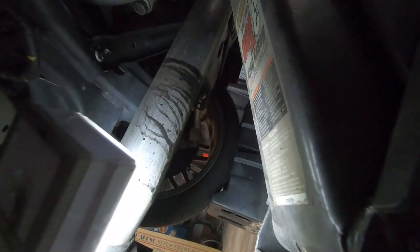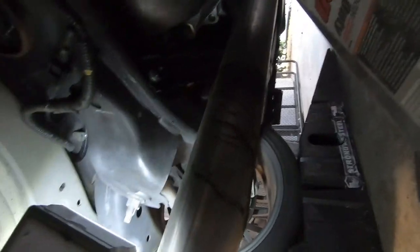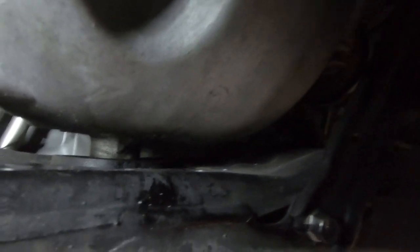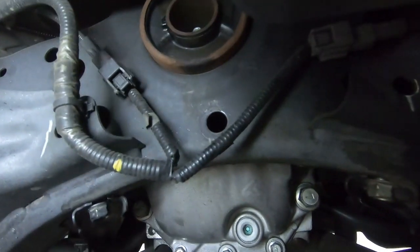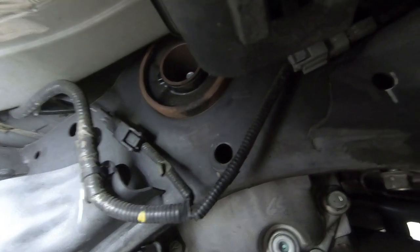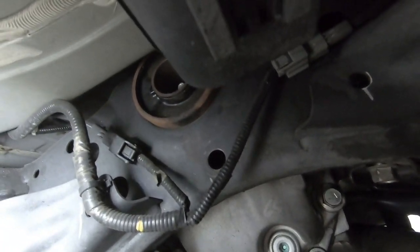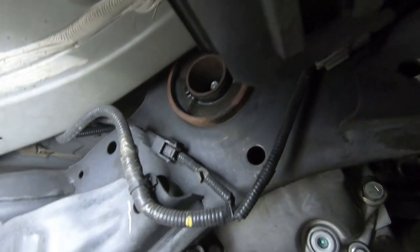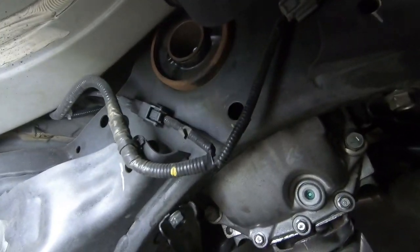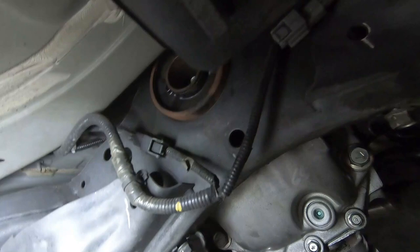You can see where it's dripped down the underside of the subframe — follow this little bracket, drip down onto the exhaust pipe. The top and bottom are separated by two solid pieces of rubber on each side of the bushing. You can see the solid pieces of rubber towards the side, but the top and bottom chambers are still connected so liquid can flow from top to bottom. Pushing on it now the bottom feels a little more firm than it did the other day; the top feels like an empty rubber bladder. I may just fill from the top and see what happens.